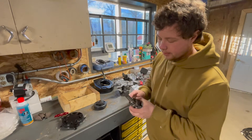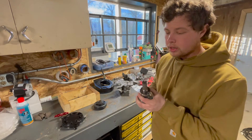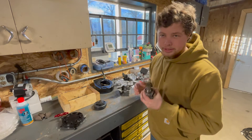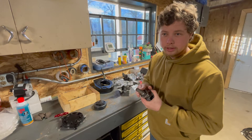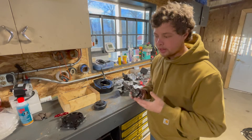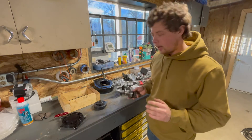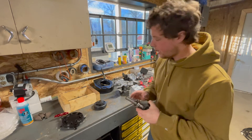I had my local machine shop take this crank and mill it down to three-quarter inch. It was not easy for them to do — this crank is super hard. And honestly, this cost a lot of money. It's not really the most economically smart choice; it cost me more to get this crankshaft machined than buying a Harbor Freight six-and-a-half horsepower engine new in the box. So I'm not going to say this is a great option, but I wanted to make it right and make this thing work. We got this thing milled down — it's a three-quarter shaft now.